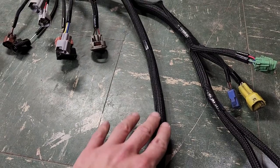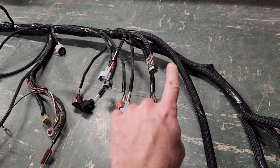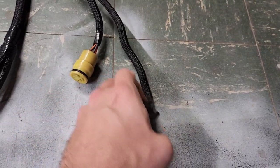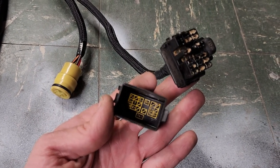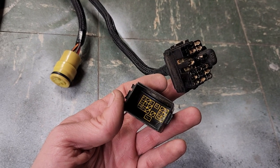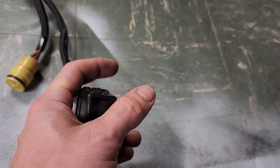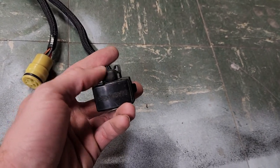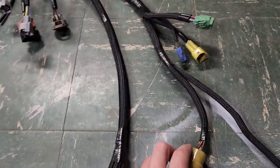This part of the harness goes over right behind the cam gear covers up to the first junction point. Coming down this leg, the farthest connector is the check connector — this is where you check for codes. You jump pins TE1 and E1 to check for engine codes. Jumping B-positive and FP bypasses the fuel pump relay and fuel pump resistor to check fuel pump operation. These things break all the time; that's really all they're used for anymore.